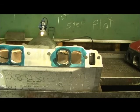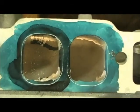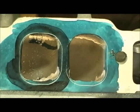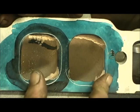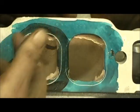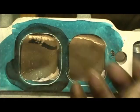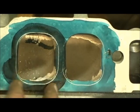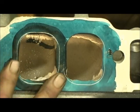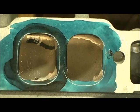Now like I said, a ton of meat has to come out. Looks like it core shifted pretty bad toward the roof of the port, meaning all the meat has to come out of the bottom. I wish it would have been more on top — I'm a raised roof guy — but it is what it is. When I plant the shape, it doesn't matter anyway. In order to make this come out to the manifold it's going to have to go almost two and a half to three inches in.